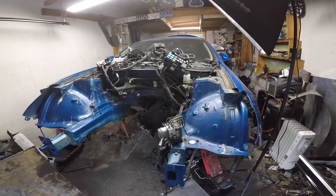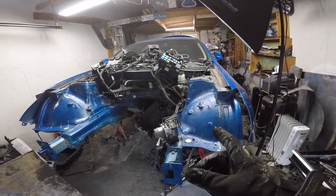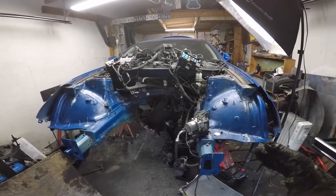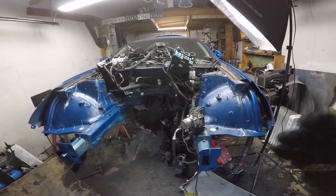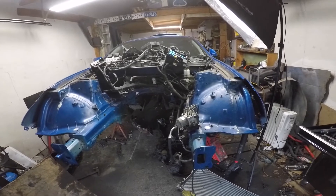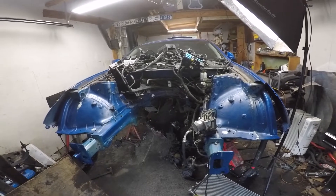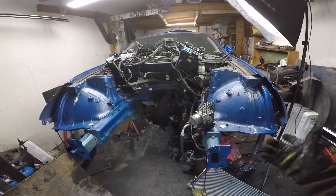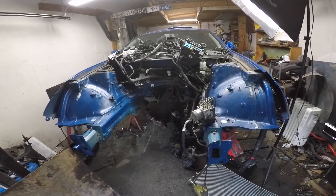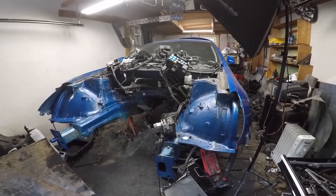Sadly in Canada, the difference between a base model and the GT is really only the brakes. Because all these cars in Canada come with an LSD — so even the base model Genesis in Canada, the 3.8, came with an LSD. I actually kind of want to weld one of these LSDs. They're not the Torsen LSDs — really not the most reliable out there, you're definitely going to get some slip, and when you're drifting slip is not good. A welded diff is solid — I was street driving a welded diff, you chirp it a lot but it is doable.